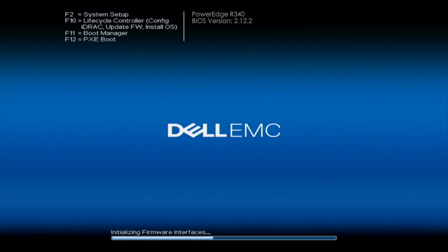You also want to make sure that you have a minimum of 3 drives installed in order to configure RAID 5. This is something that's specific for RAID 5. RAID 0 and RAID 1 have different minimum drive requirements. So go ahead and research the drive requirements for the desired RAID level that you are looking for, and then just make sure you have that number of drives installed. And if you want to install more than that minimum, then you're more than welcome to. But specifically for this video, you're going to need a minimum of 3 drives plugged into your server.